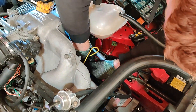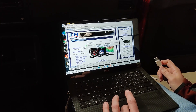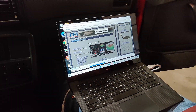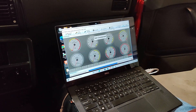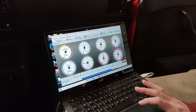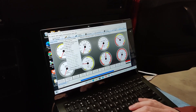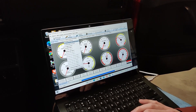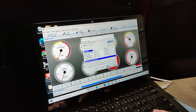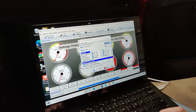We'll jump into the car now and get this thing set up on the Mega Squirt. We'll do the firmware update later because it'll still run fine as-is. USB is in — we'll click on our project and turn it on. You can see it's connected and everything's getting a reading. Now all we need to do is go into our flex settings. Under Fuel Settings > Fuel Sensor Settings, click this and we're going to enable it. It's already wired up using the flex wire as the input, and it's going to require a restart to burn.